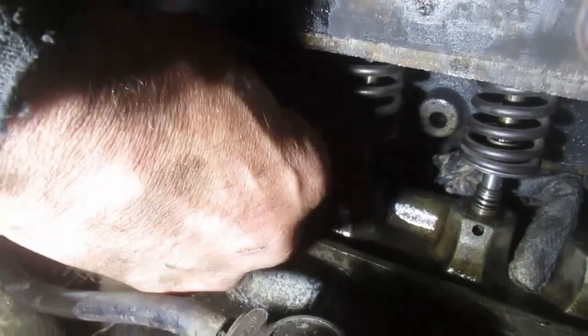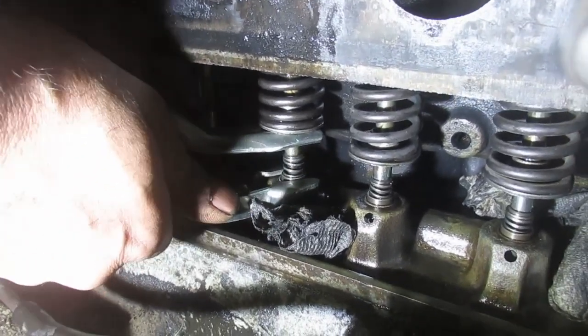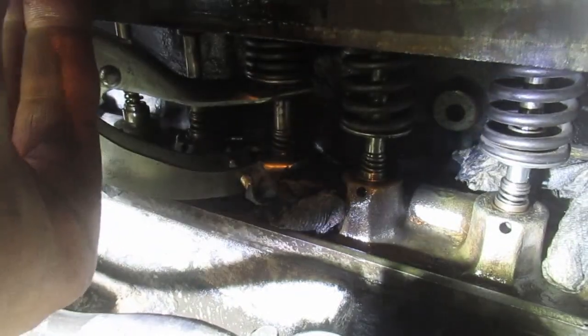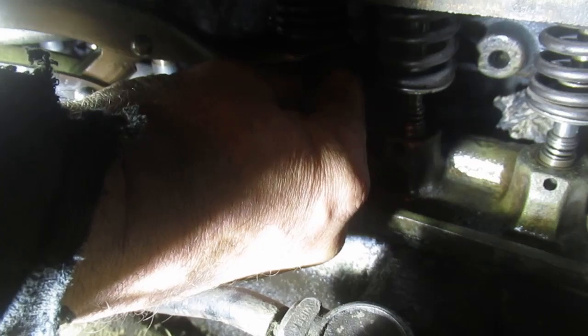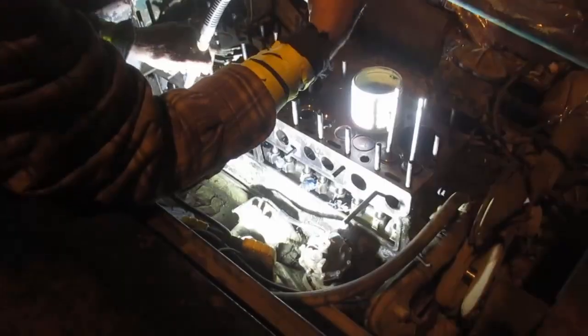Just perfect. So what you gotta do is seat it there. The top one goes on the little boss there. And then you just push the whole works up till it's well out of the way. Then you get your keepers, which are ready and greased. You put your fingers in there and slide things around. At some point you should hopefully land in the groove. And then you get to undo it with your fingers in there, holding and hoping that it doesn't come unglued. At a certain point, you have to just abandon ship and hope that they stick. Any rags? Brand new.